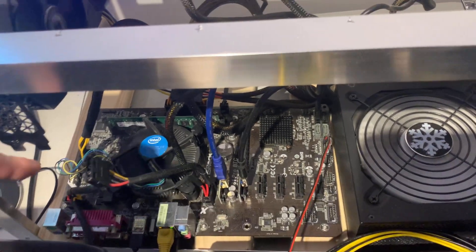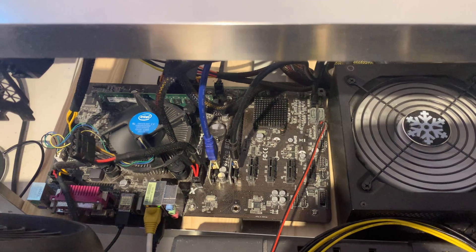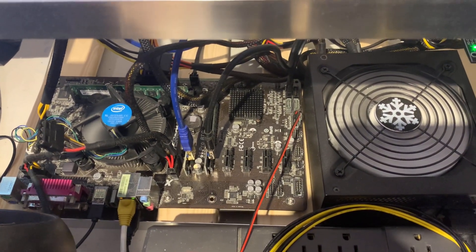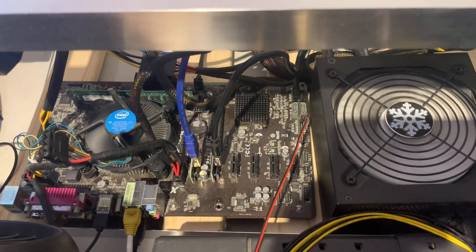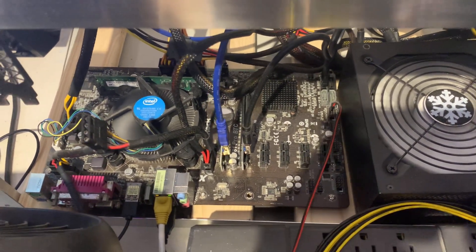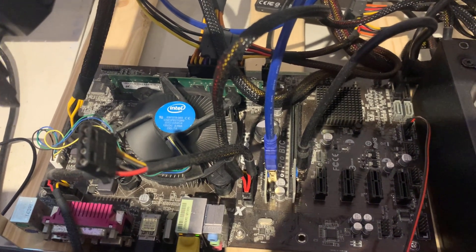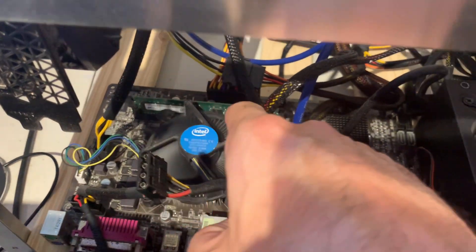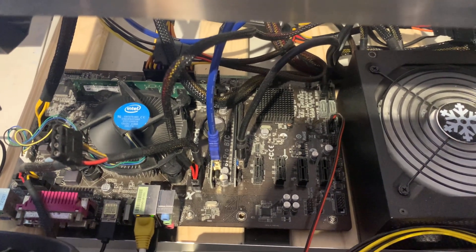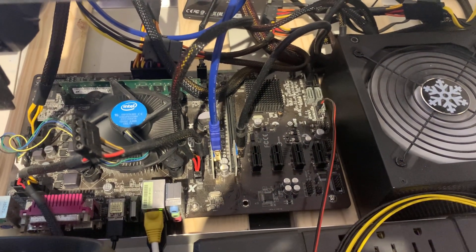Other parts that can break, although extremely rare, include the CPU, which is underneath this fan. I haven't had one break yet, but I've seen incompatible CPUs — they'll fit the socket of the motherboard, but you always have to check the manual to see what CPU is compatible. Bent pins on the CPU basically means it's broken. Another point of incompatibility is the RAM — I have a four gigabyte stick here. I haven't seen broken RAM, but I've seen a lot of incompatible RAM, so always confirm compatibility and try a different stick if you suspect the one you have isn't working.